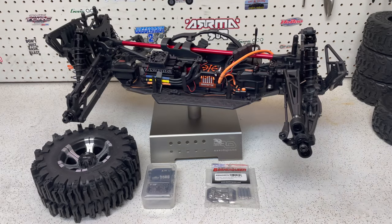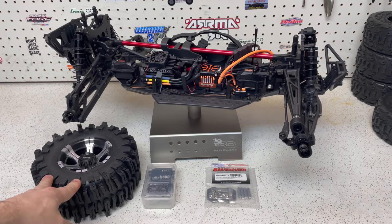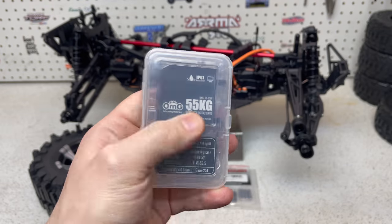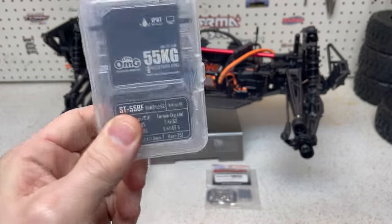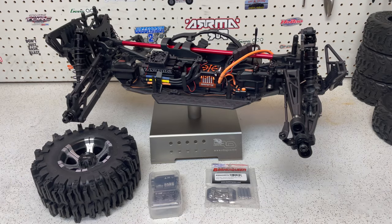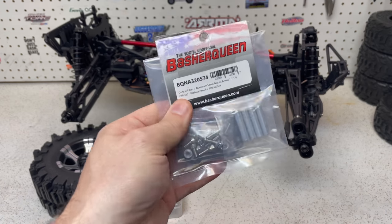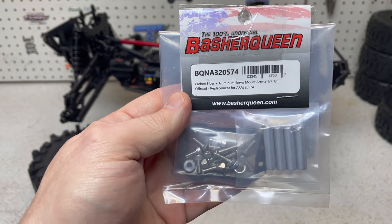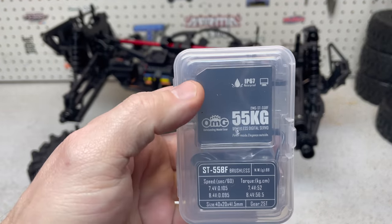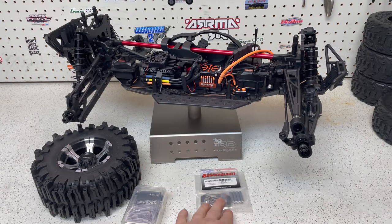The stock servo has been good with the stock wheels and tires, and was even good when I was running the MX38. However, since these weigh twice as much, I've decided to upgrade the steering servo. I'm going to be installing an OMG 55 kilogram servo — this thing should be somewhere around 700 ounces of torque, so it should be an absolute beast. I won't be installing it in this video because I want to show you guys these wheels and tires with a stock servo first, and then show you the difference with the upgraded servo. I also have a taller servo mount from Kim — the Basher Queen — which should allow me to install that larger servo on the truck.